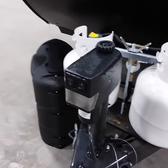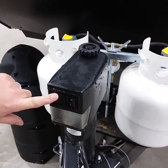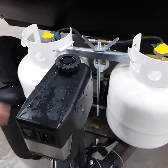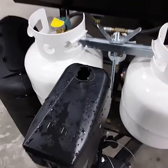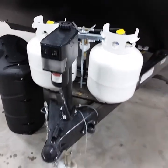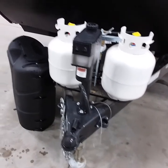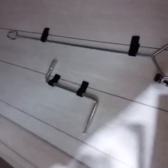The power tongue jack on this coach has a nice light, and up is up and down is down. If it ever fails, remove the cap and inside there is a crank — also located in the front compartment — that you can use to manually raise or lower the tongue jack to get on or off the vehicle.